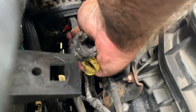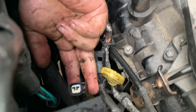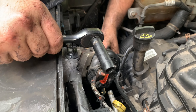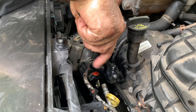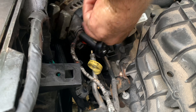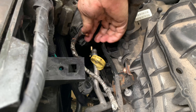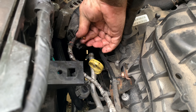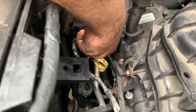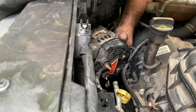The third bolt was coming out — now it's loose enough to take out by hand. Another tip: if you have that last bolt loosened a little bit, you can actually hold the alternator by hand and move it up and down to make the bolt come out easier if it feels stuck. I now have the second bolt coming out — that's what it looks like. I'm going to set it up here out of the way, and then take this third one the rest of the way off. As you can see the alternator is pretty wiggly by now. I can feel the third bolt is almost all the way out — sliding it out now — that is the third bolt.